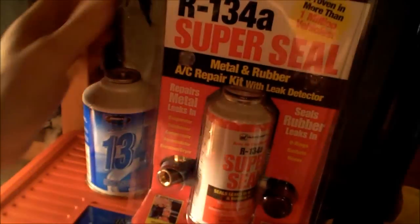You will also need — if you have a leak in your system like I potentially do — you will need to either find the leak or find a can of sealer. The problem with sealed systems like mine is it's virtually impossible to find the leak. I tried the water trick, spraying soapy water around everywhere inside, but because half of my coils are embedded into the outside, it's almost impossible. I did it three or four times, checked leaks around the compressor and around all fittings — nothing.